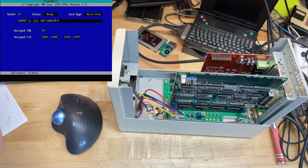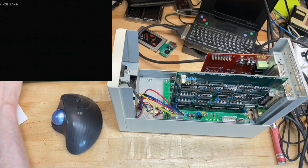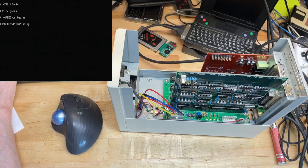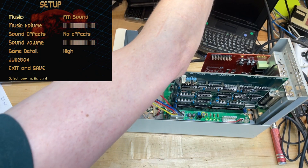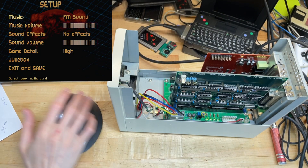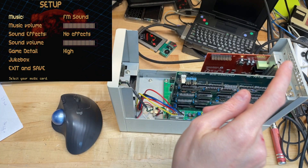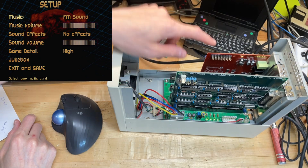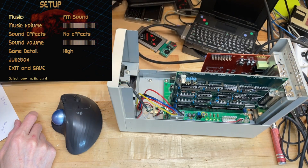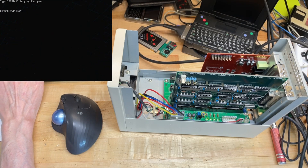I can't do Gravis Ultrasound because it obviously needs the 240 range and then the 340 range, and you can't configure that. So I have it set right now to do 380 to 39F. Just for fun, I'll show that the PicoGus has the AdLib firmware on it. This is the PC110's PCMCIA using the Gravis Ultrasound card, and I thought that was fun.